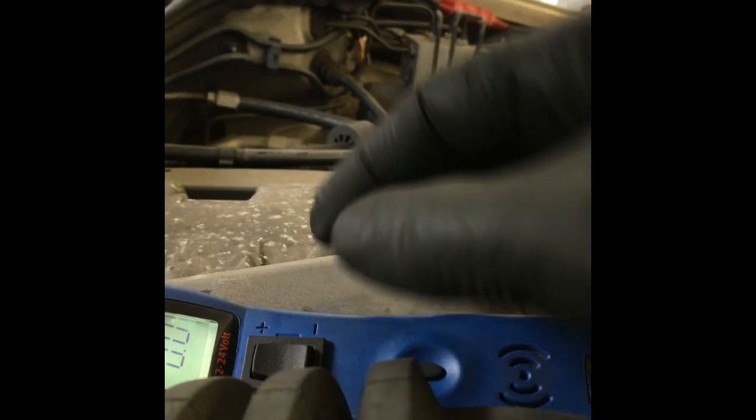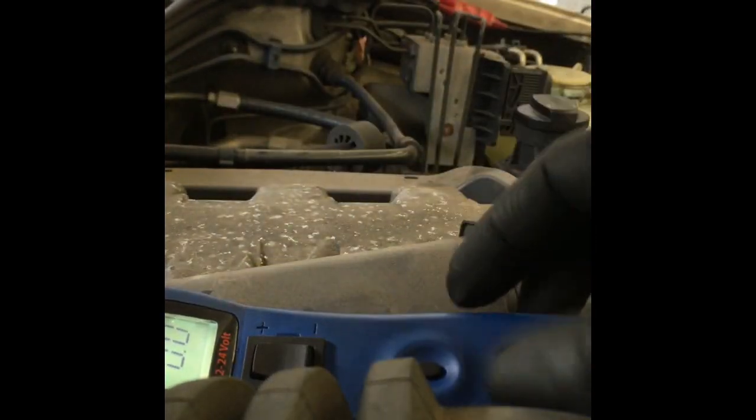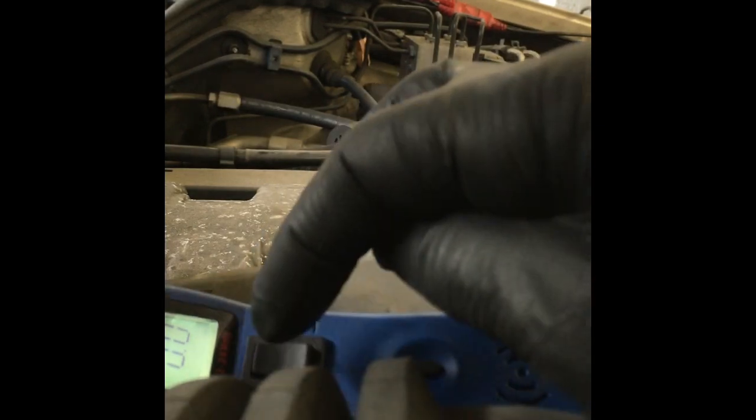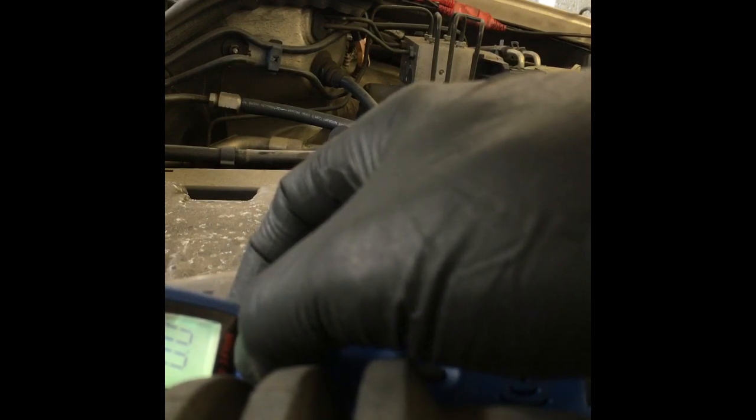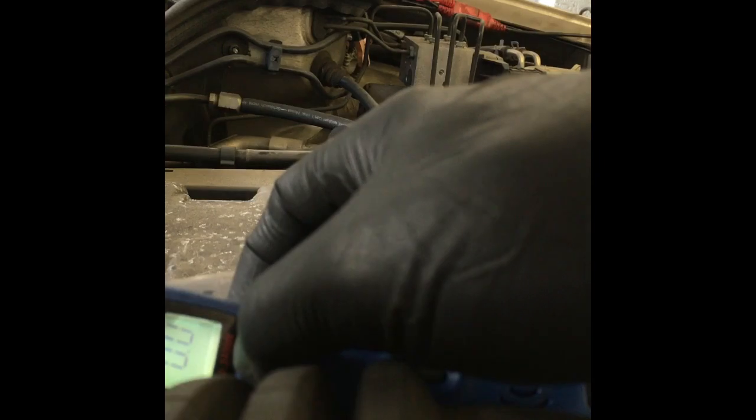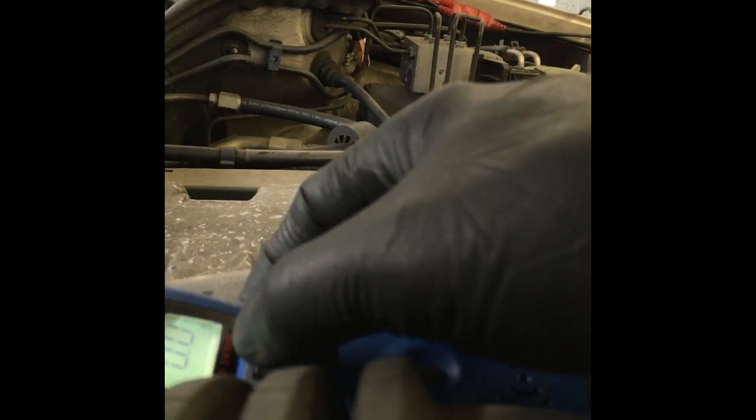I've got the engine running and the power probe rigged up where the negative is on terminal 2 and terminal 1 is the power. I'm going to supply power and listen for the engine to stumble and hesitate a little bit. On Mercedes it doesn't do a whole lot — on GM cars it'll almost stall the engine, but on Mercedes it just makes it stumble a little. Applying power right now... So that means our EGR port is open and flowing, our EGR valve is working, the vacuum supply to the switch is there, and the vacuum switch is working.